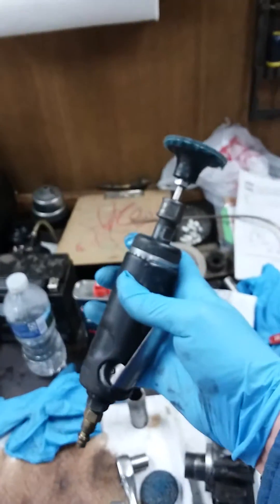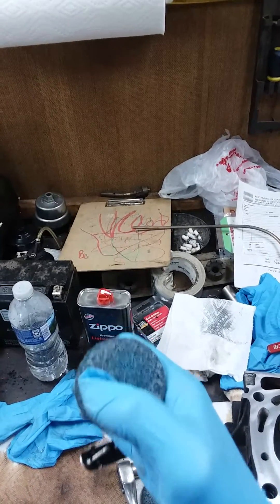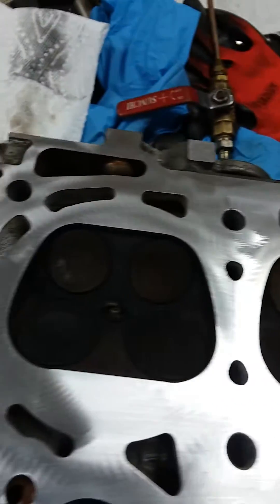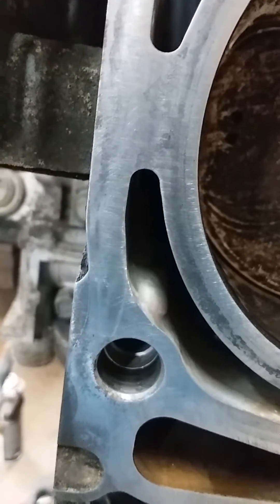Another thing is this little handy-dandy tool right here — like a little die grinder, except you buy this little end and put it on there. Get the real fine grit, works great. See how it surfaces the heads? This one has been milled down and then I had to bring it back because they didn't do a very good job. Nice and smooth — I just kind of cleaned it up. Also did this over here with it. This is about as clean as it's going to get with this.